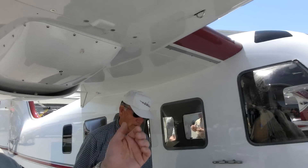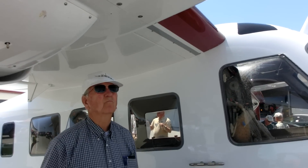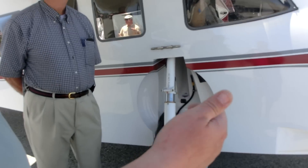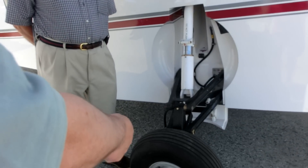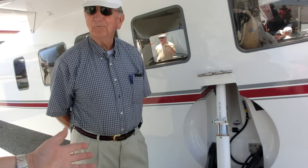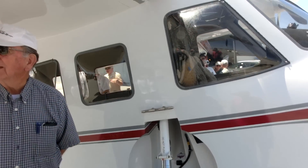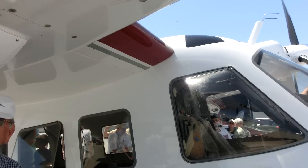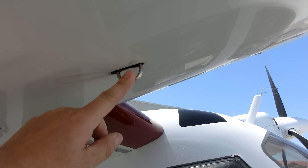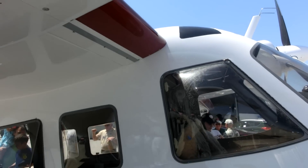When we first started flying the airplane, one of the first times we went to fill it up with fuel, the guy on the gas truck came with his grounding wire and went to clip it onto the wheel. We said, wait a minute, that's not really going to work because it's attached to fiberglass. We started looking around and there was no place to hook it. So we put this in — this is a grounding strip that's attached to the ground for the engine and the airframe.